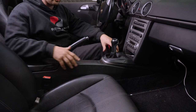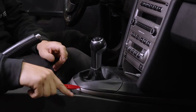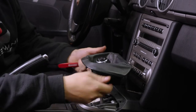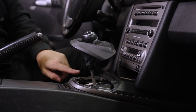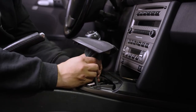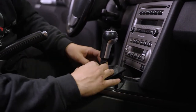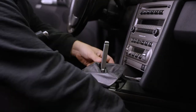To do this install we're going to have to remove the center console to expose the shifter box below. To start, we're going to remove the shifter boot by putting our pry tool in between this piece and the plastic piece. It'll come up just like that — there should be a clip here, here, and here. Once you have the shift boot lifted, there's a collar right here that needs to be in the correct position to release the shift knob. This can be kind of tricky, but if you twist it in the right direction, this piece will pull down and then you can just lift the shift knob right off.